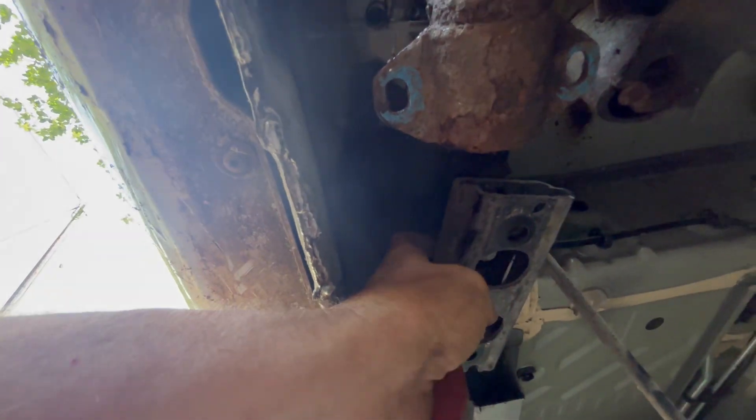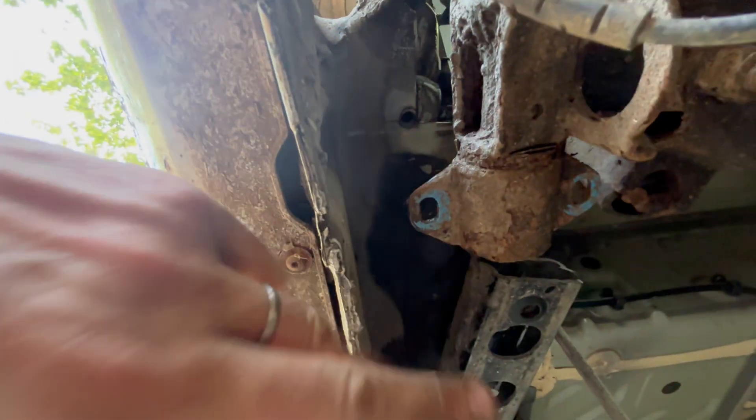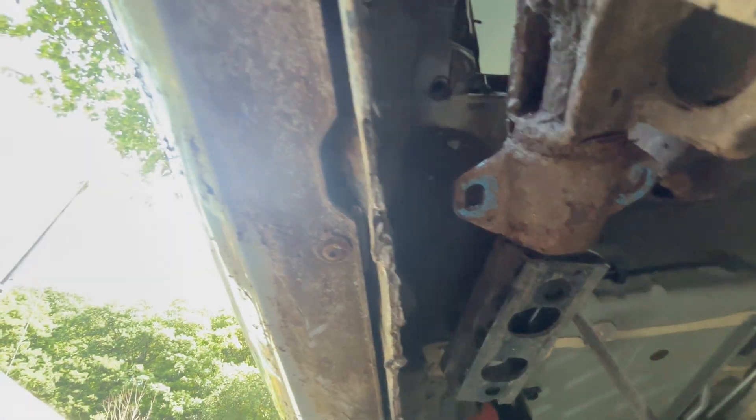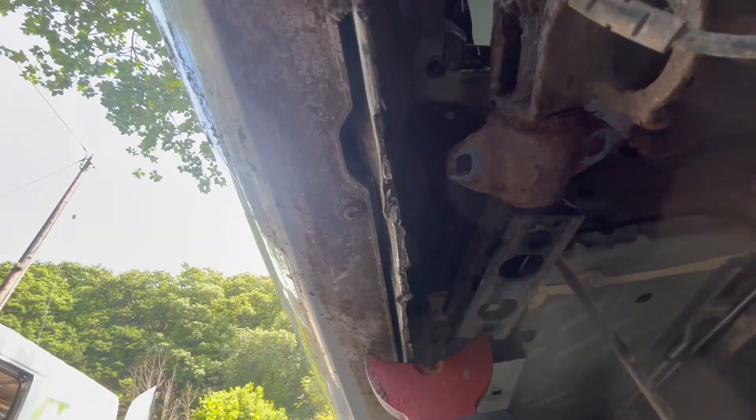Underneath here is the battery mount box, so we can take that off and that gives us some bolts that go into a bit of box section here. We've got some screws and nuts coming through into this thing just here. We basically wanted about this level, just because of the way the MGF works to the sill height - if we have it higher up, we're going to get too much of an angle on this subframe. We want it to be sitting level, just like it was in the MGF. So we've got a good hand's width - that much - that we've got to make up so we can bolt into this thing at the top, but have something to bolt into this.